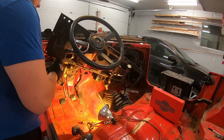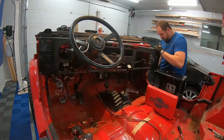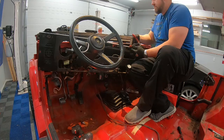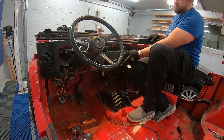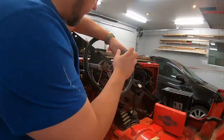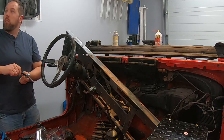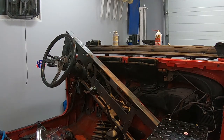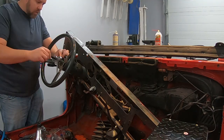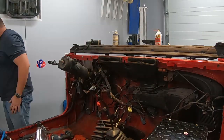The climate control system is out, and now trying to take the dash plate out — discovering the steering wheel is in the way, which is a little frustrating. Throughout this I would label all wires with my label maker to say exactly where that wire came from and where it connects, and I take a lot of pictures — probably 500 pictures just to this point. So now we're taking the steering wheel out. I had to go buy a steering wheel remover from Princess Auto, put that on, and once it was on this was actually quite easy compared to some of the other grief. It pops right off, and now I can finally get the dash plate off.